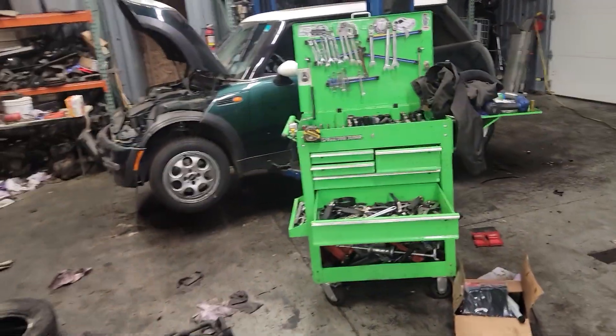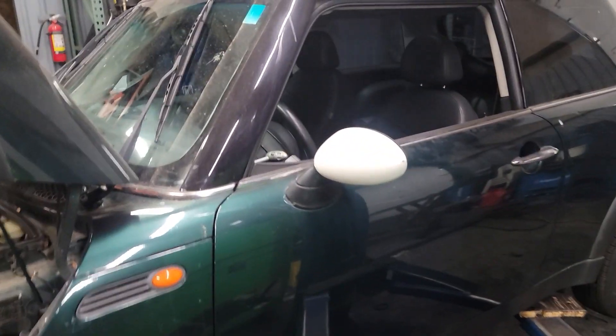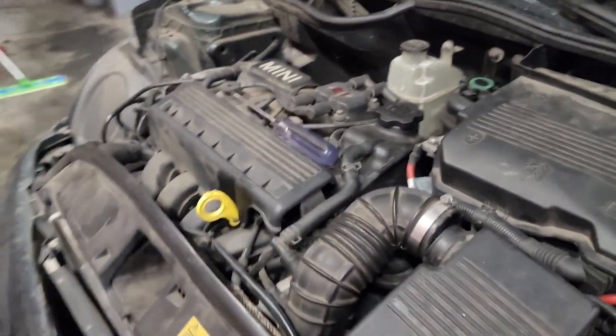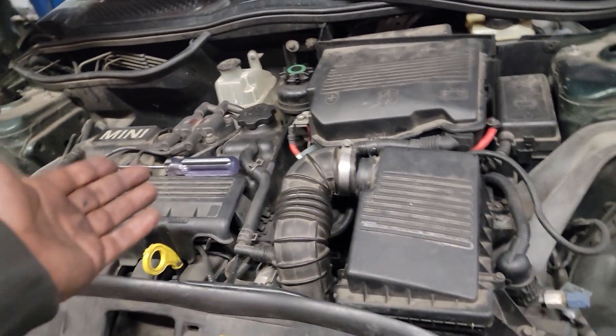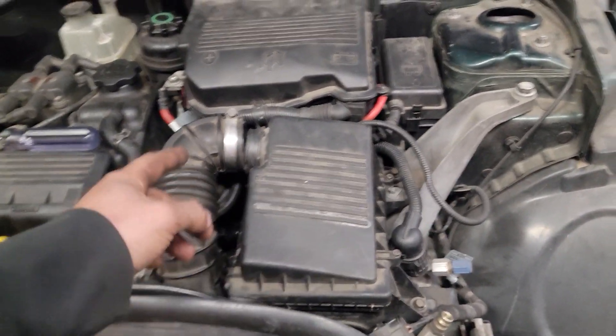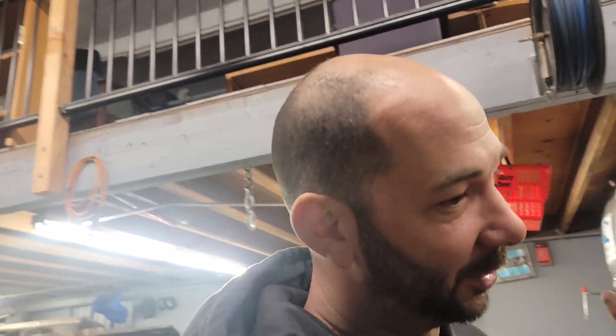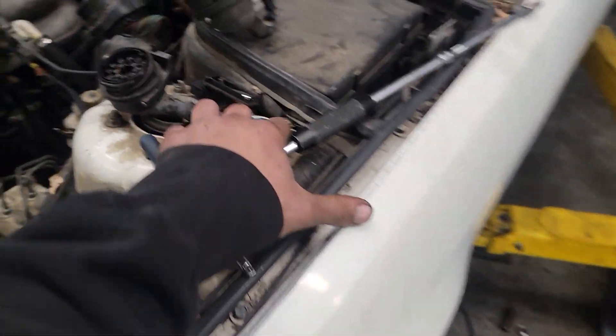I got the Mini in here. My buddy CJ — I thought he needed a clutch, definitely doesn't need a clutch, he needs a slave cylinder. He's pretty excited he gets to return his clutch. I'm a little bummed this is a non-Cooper S, just a regular Cooper, so the slave cylinder is on top of the trans instead of below it — I have to take out the air box, battery, and battery tray just to get to it. I was gonna save him about a thousand dollars, so he's pretty excited. I'm glad I don't have to fully pull a Mini apart, because at Zach's I had to do a head on a Mini that turned into an engine swap, twice — it about broke me.